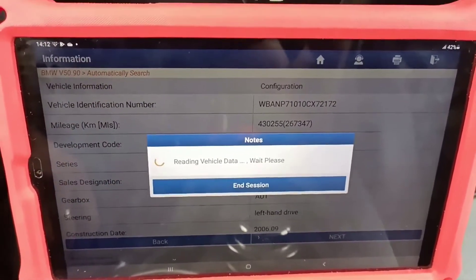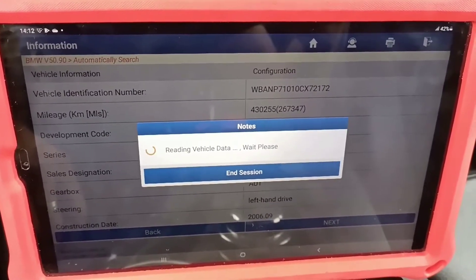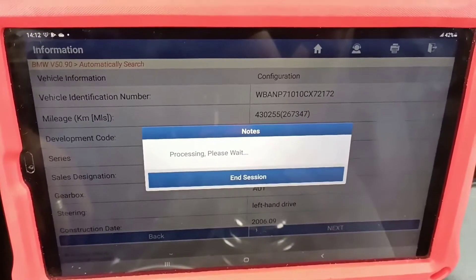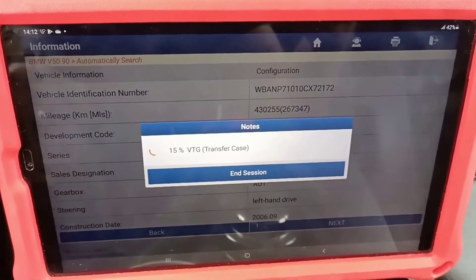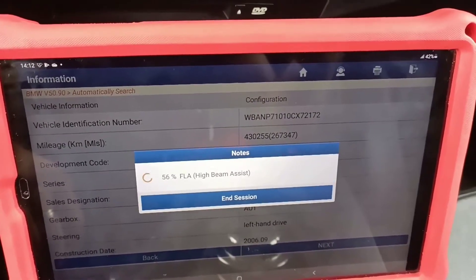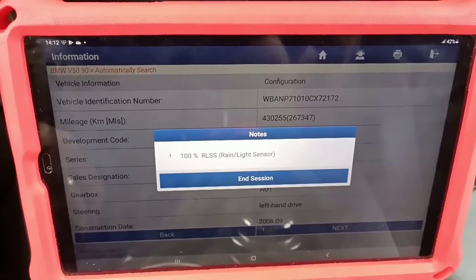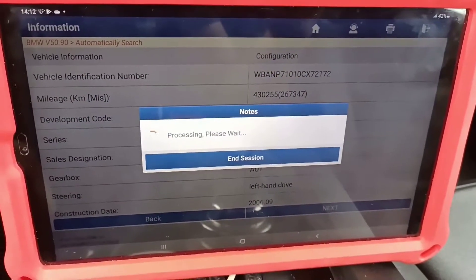Before going to scanning, I know the car has a problem with the VTG module. And what I want to show you is this new topology is not as precise as you might believe. You cannot compare this with normal OEM software like BMW software, where it will show you exactly that you have a problem with a connection. On this new topology, it will show the module is not fitted in the car, but this is not true — because as you can see, this is an automatic gearbox, and you should have the VTG module.